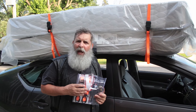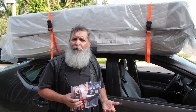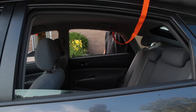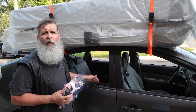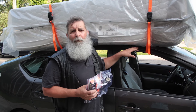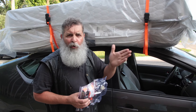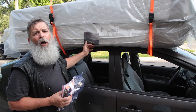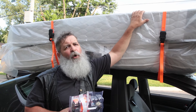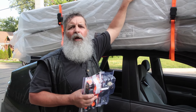I've showed you how to do it safely. We're going to use ratchet straps — make sure they're good ones rated at least 400 pounds. We're using two of them; you could use three if you wanted to feel a little more secure. We've opened the windows and gone through all the way around with the straps through the windows. When the vehicle leaves, the windows can go up and be closed tightly, so if you're running your air conditioner or heat, you don't have to drive with the windows down. On the driver's side where the driver is entering and exiting the vehicle, we opened the door and went through and then closed the door on the strap. Remember not to over-tighten the straps because you could break the wood of your box. But you can get it just right so it's solid and becomes part of the vehicle, and you can transport this down the road anywhere you want to go.